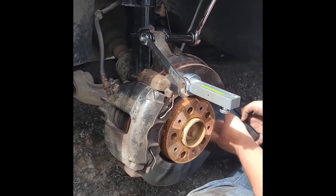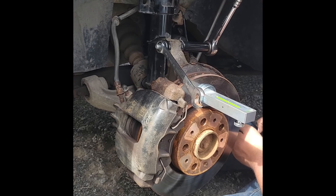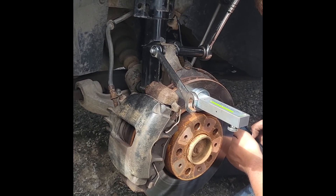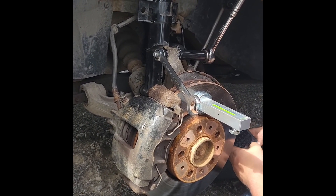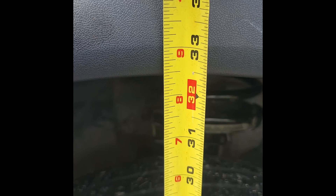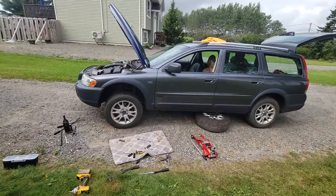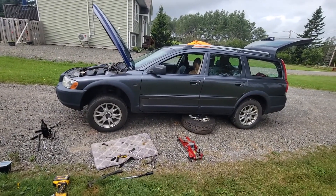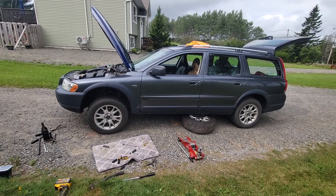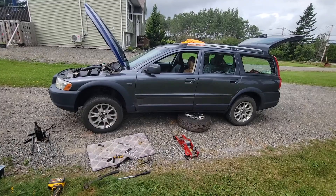Side number two went considerably easier. We're ballparking the camber with a magnetic gauge and checking how much lift we got in the front — 32 and a half inches. There's a Carolina-squatted Volvo. Two inch lift in the front, nothing in the back yet. Let's run her.